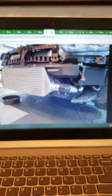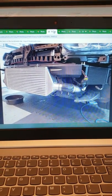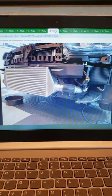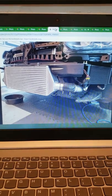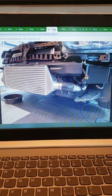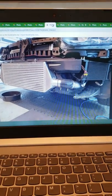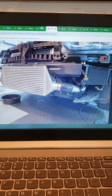My configuration: I recently installed an external oil cooler, which you can see on the right, and I have the Pack Parts front-mount intercooler integrated into the crash bar. The idea is to run the nozzles on the line within the bumper to direct them at the intercooler and even the oil cooler to spray them down based on whatever control you want. That's the surface area I'm trying to cover with the jets.